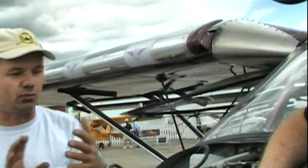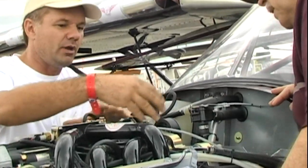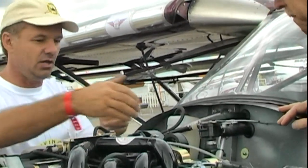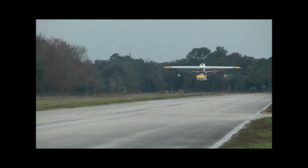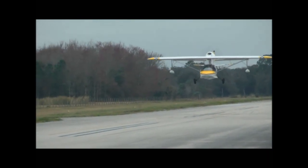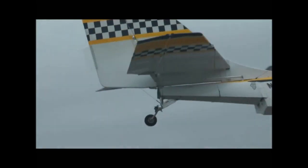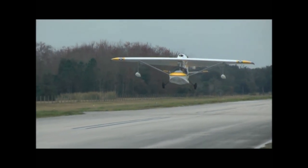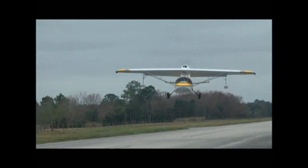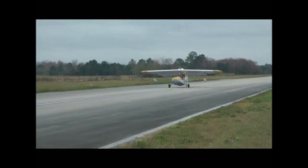We have mounting for both inboard and outboard mounting depending on the width of your airframe. The inboard mounts bolt up to a Jabiru-type mounting. It's all aluminum, mounting up to a steel frame. The idea was to have an inline-four because it simplified everything — as soon as you put four cylinders in different places, you have four intake pipes, four exhaust pipes, wires going to four different places. With the inline-four, everything is right here in one place, and the exhaust too is just one exhaust right underneath the engine.